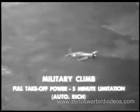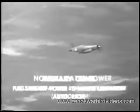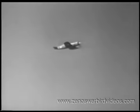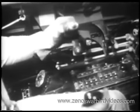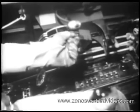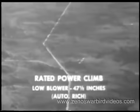You can use your full take-off power for a military climb of about 3,000 feet per minute, but after five minutes you must throttle back to normal rated power for continuous operations — 43.5 inches at 2,550 RPM in neutral blower. With this power setting, your rate of climb will be about 2,000 feet per minute at a best climbing speed of 125 knots. At about 8,000 feet, you will have lost about three inches of manifold pressure. If you want to continue the same rate of climb, you must throttle back three to four inches of mercury, open the intercooler flap, and shift to low blower. Then increase your manifold pressure to 47.5 inches and keep climbing.